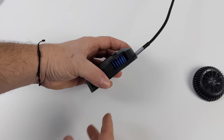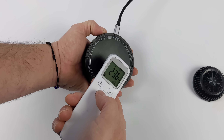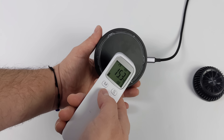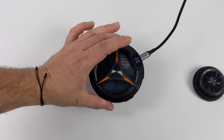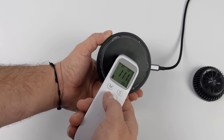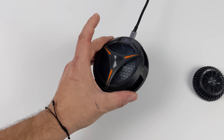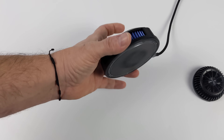The larger cooler is basically the same thing, just in a larger form factor. It has a power switch and two modes — I'm going to go to full blast mode. Starting at 23.6 degrees Celsius, as soon as we power it up the fan starts spinning. We drop to 15.3, then 12.8, and this actually goes as low as 4.4 degrees Celsius. The LCD readout shows around 10 and usually drops to zero — I've seen it go to minus. The infrared thermometer reads 5 degrees Celsius, and you can see condensation building on the back. I checked the wattage with a kilowatt meter — it's pulling 18.7 watts.